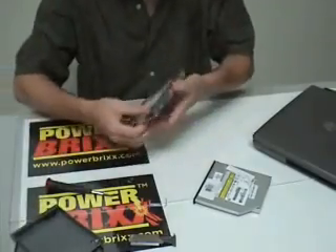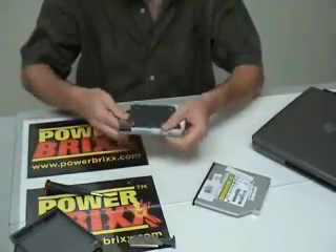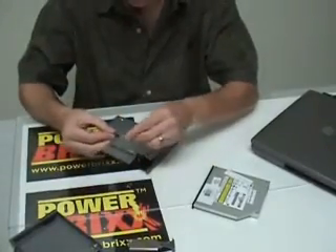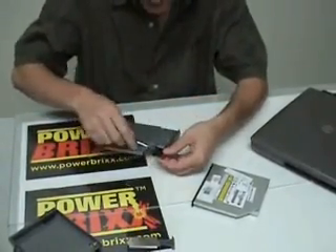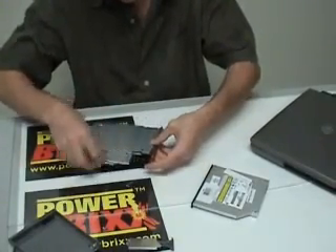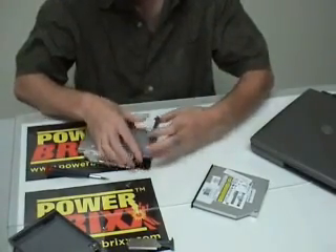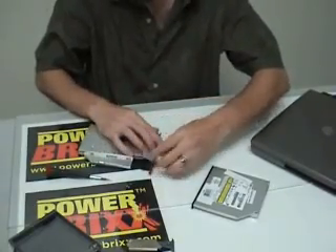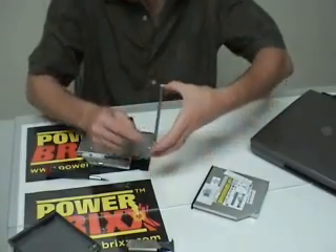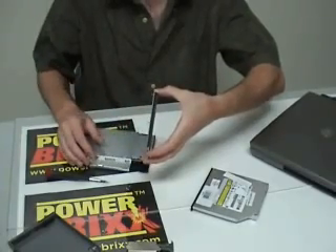So this was the Dell drive. I'm going to eject the drive mechanism here. What I need to do is remove the bezel. I'll take my Husky screwdriver and apply a little bit of pressure to open up a slot here to allow the bezel to come off — then I just roll it off, working it out a little bit and bending it slightly as I pull it out. It releases hooks that hook onto plastic anchors on the inside of the drive plate.